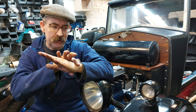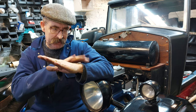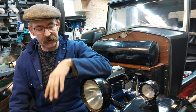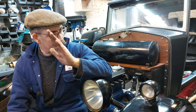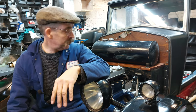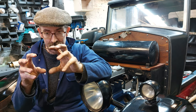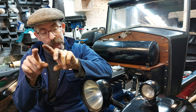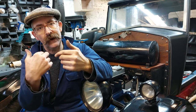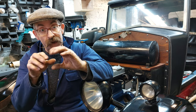But just a lever bar placed between the hand brake bracket and the brake bracket behind it was enough to release it. So once I got that to a more level angle, it was easier to slide the engine on. The difficult bit was lining up that clutch basket, and the pins that it slides on, and also the clutch operating arms, one of them had dropped down, so it was jamming under the flywheel.